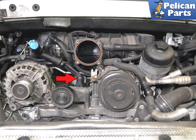Unfortunately, modern 911 motors are getting packed in tighter and tighter. To remove the resonance tube on the 991 Gen 1, you will first need to remove the engine cooling fans, tail lights, rear bumper cover, air box, and throttle body. I also like to remove the oil intake tube to give me some more room. For assistance with all of these tasks, please follow the link provided at the end of this video.